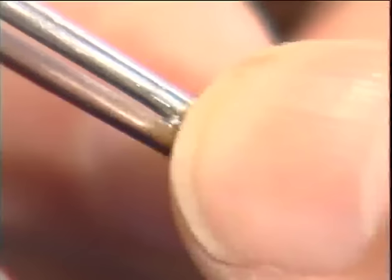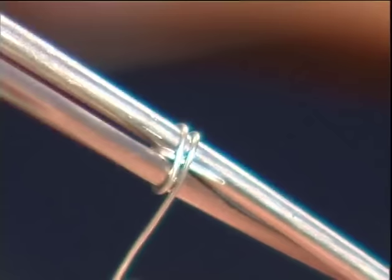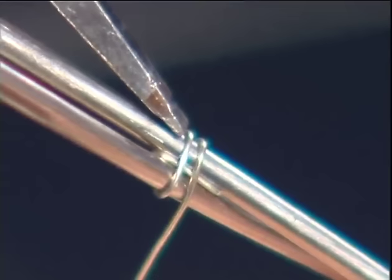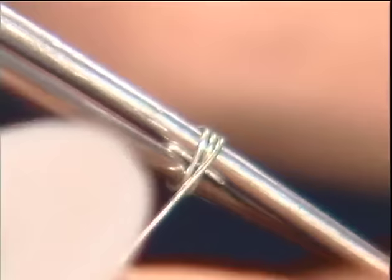In addition, if the wheel encounters any sudden radial overload due to hits from stones, curbs, or potholes, then the peak stress encountered by a single spoke is decreased thanks to the dampening effects of its co-soldered spokes. This means that tied and soldered spokes support each other.